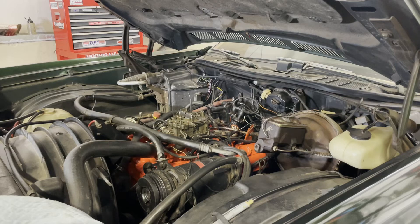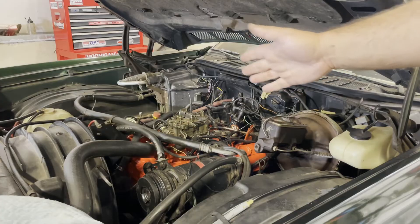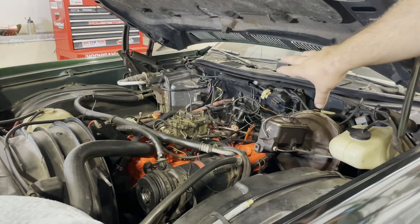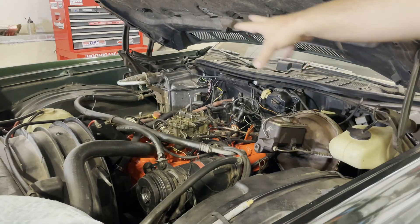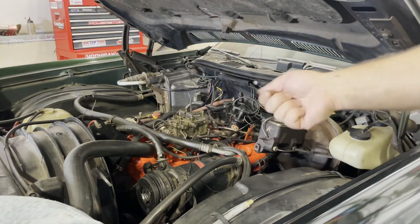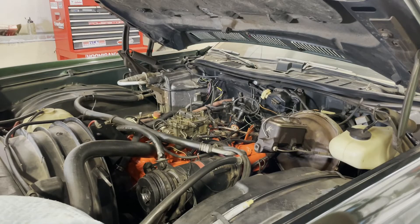Fairly simple overall. You do need a timing light, and I have the specialized wrench because on Chevrolets the distributor is behind the engine near the firewall, so it's a reach. Fords have it in the front and are much easier to adjust with a straight wrench. That's how you set timing — very simple. If you have any questions leave a comment below. I'll leave a link to a timing wrench like that below, and if you found this useful click like and please subscribe.